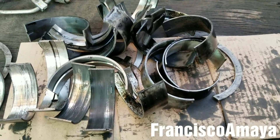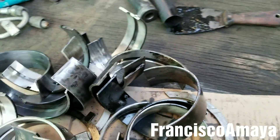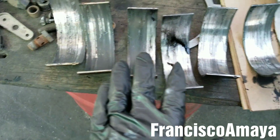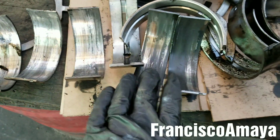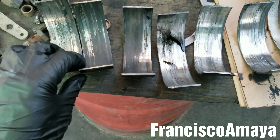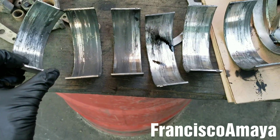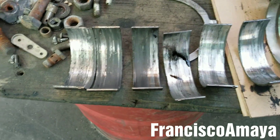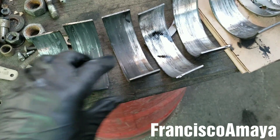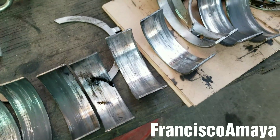Remember at the beginning of the video I told you this engine was in real danger of getting seized — it was about to get seized. Four of the rod bearings were just about to get seized. These four rod bearings had no lubrication at all because the old suction module was broken.